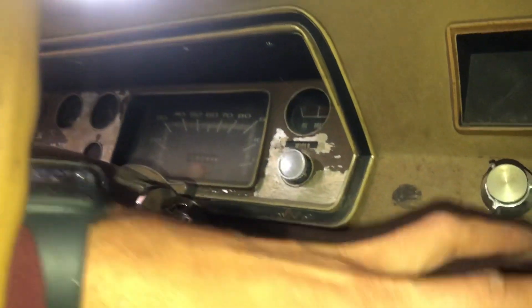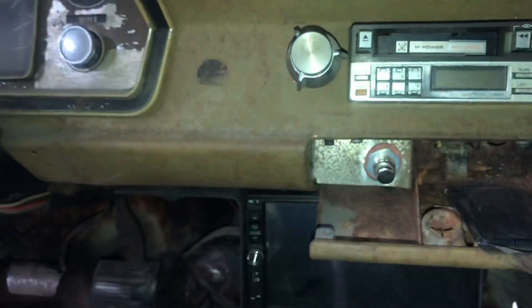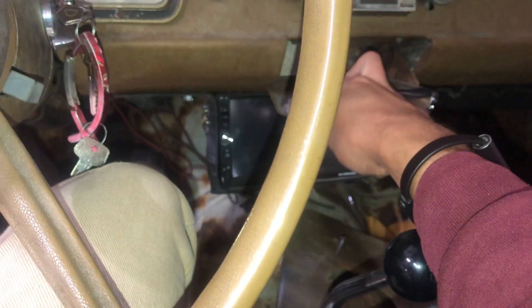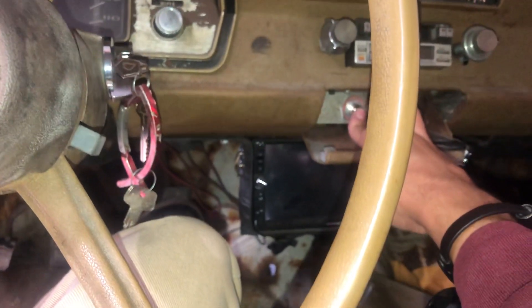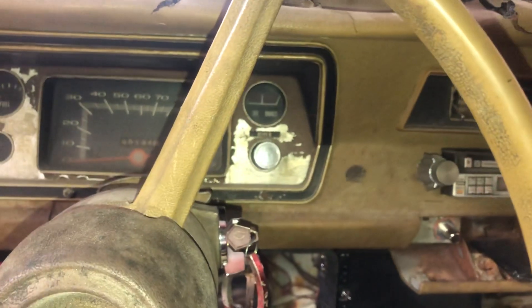That's pretty much my situation — doing that dance over and over. It'll still work, but it's not good. This will never let it turn over and start running if I don't have that key turned on. So I always turn that on. This is pretty much what I've been doing to get it started — going back out there, putting some starting fluid in the carburetor, waiting a few seconds, and trying to get it to run.